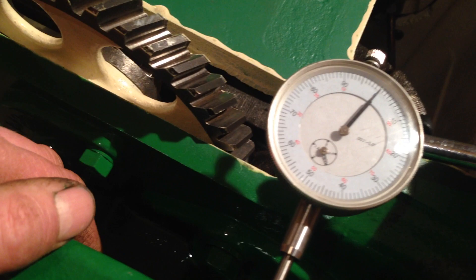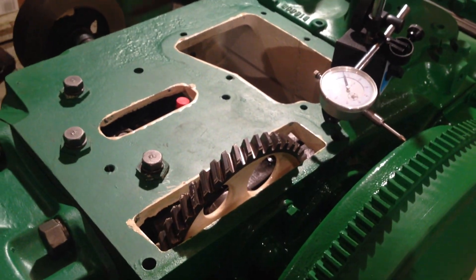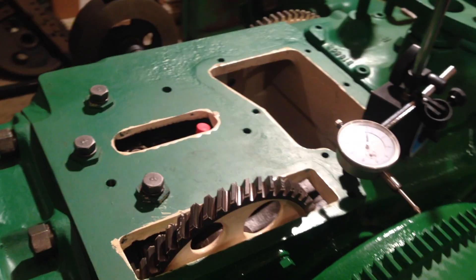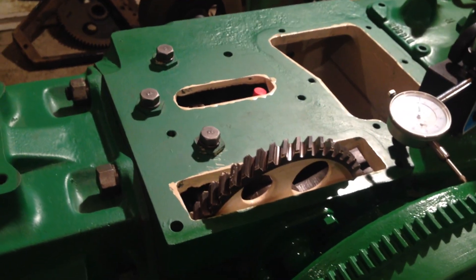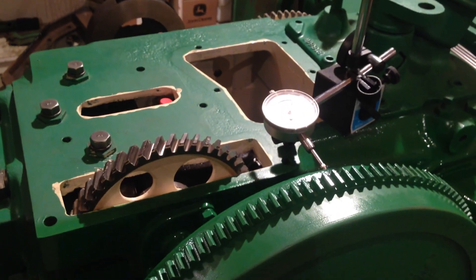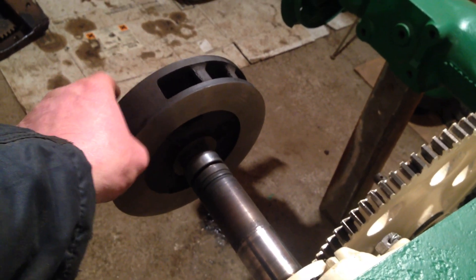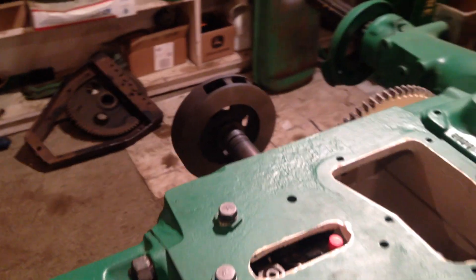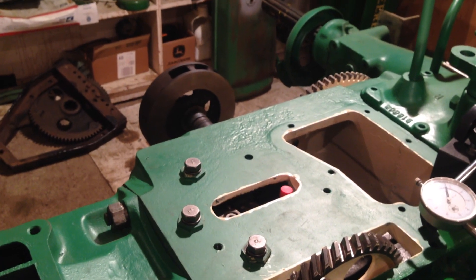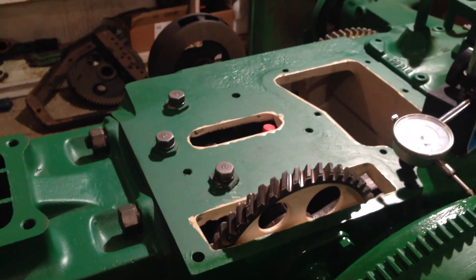Back to zero and you can hear it clunk in there. In the workshop manual it does suggest you use the clutch lever and work it backwards and forwards a little time or two, and that sort of beds things in. The hand-start ones notoriously come slack, and the way the clutch works by snapping the two friction discs between the driver doesn't help, because the action actually pushes on the crankshaft and works on that end float gap.